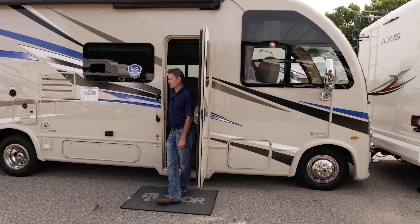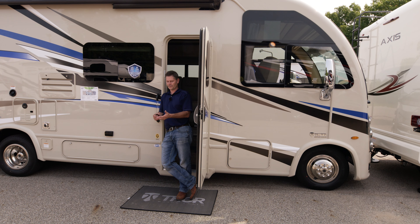When you're driving down the road, your house batteries are going to get a charge. When you're plugged into shore power, your house batteries are going to get a charge. If that switch is off, they will not charge. Keep it in the on position the entire time, and turn it off when you're going to store your motorhome. Keep in mind there are items like clocks that have a small drain on your battery, so you will drain your batteries dry unless you disconnect them. When we go over to the power side, I'll show you the little adapter you can use to plug into just an outlet where you store your motorhome to keep the batteries charged.